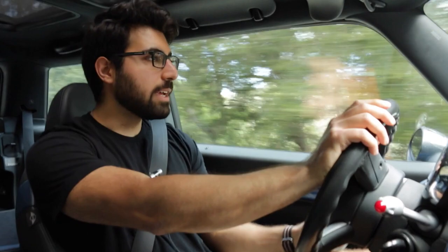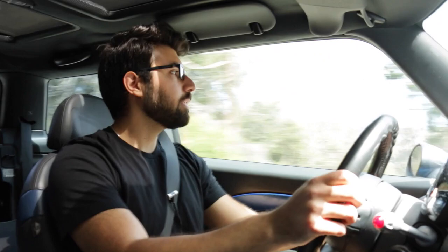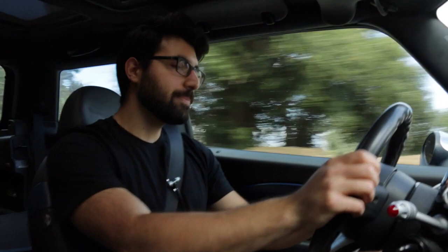I've got Ireland Engineering fixed camber plates up front paired with Hotchkis Sport rear control arms and a beefier rear sway bar from Hotchkis Sport. That overall suspension paired with the Koni Sport yellows and Swift Spec-R springs gives a very neutral handling experience. It doesn't understeer at all — you never feel any understeer. The only complaints I could have with the handling probably have more to do with the driveline configuration — it being a front-wheel drive car it's inherently going to have some torque steer, but honestly it's not that bad.